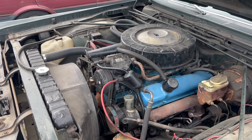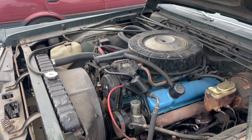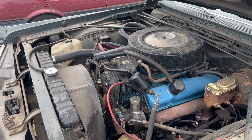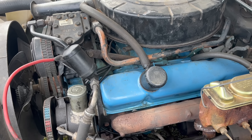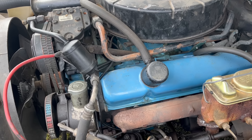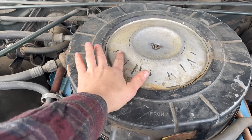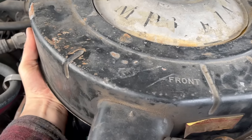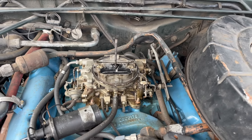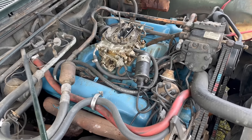Now, we've been led to understand that this is a rebuilt 440. Unfortunately, we don't really have details or more of the story, as this car and the other one and a bunch of other things came from an estate — the owner is no longer around to ask. Now, I could be wrong, but seeing as how this is a 68, I don't think the engine should be blue — I'm pretty sure it should be turquoise. This is an original correct Imperial air cleaner, though unfortunately it is super faded and flaky. And under that air cleaner and the humongous air cleaner that I can't lift with one hand — oh good, it's a Carter. That means we actually have a shot here. As near as I can tell, they rebuilt the engine but put all the original pieces right back where they're supposed to be.